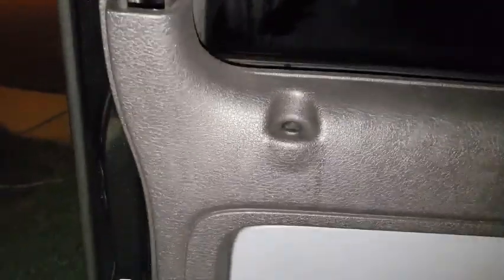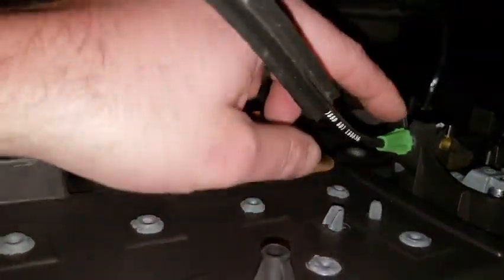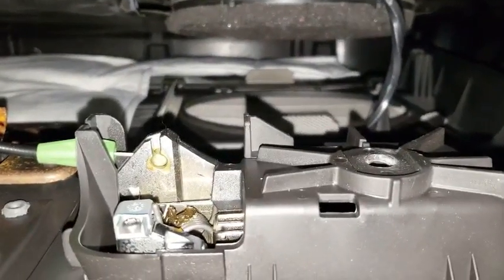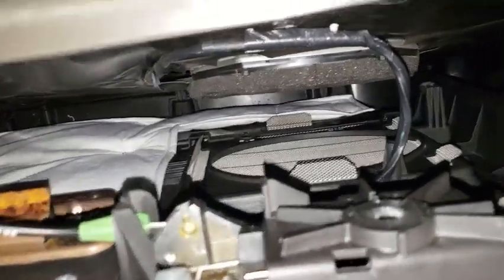Now that you have the three 6mm bolts and the 8mm out, this entire panel just lifts up and off. The bottom of the door has these clips — leave the clips kind of in their slots so you can have the door hinged forward. Down in the door you can see your door latch — same as the front I showed earlier. It's got two clips; take needle nose pliers and grab those to undo the clip.